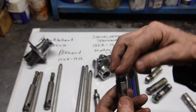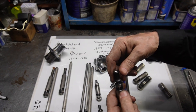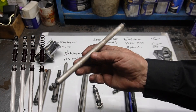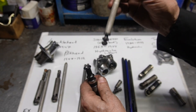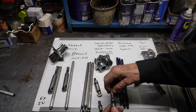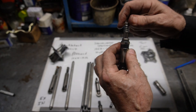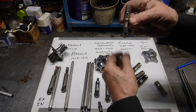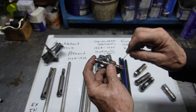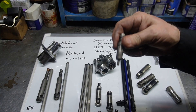Some solid conversions had a spring that went in them, and the idea was that the spring kind of dampened things. Since there's no adjustment on these at all, they usually came in a kit with an adjustable push rod that had adjustments and would sit right in the pocket — adjusted the same way solids would be. You don't want to mix up hydraulic lifters; they are a machined set and the same pieces should go back together. If the spring won't go down into the lifter, just take a small pin — there's a check ball inside — stick it in and the lifter will go right down so you can get your push rods in and do all your adjustments.